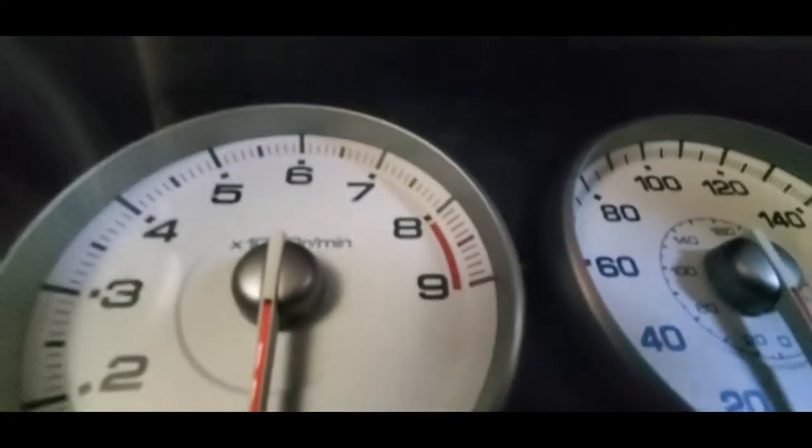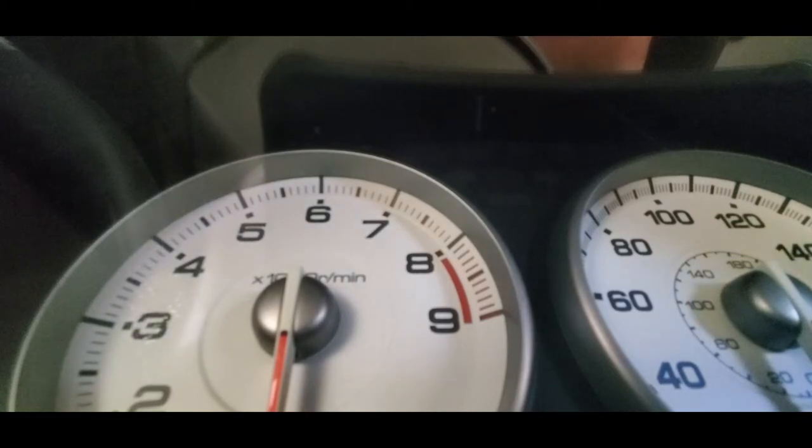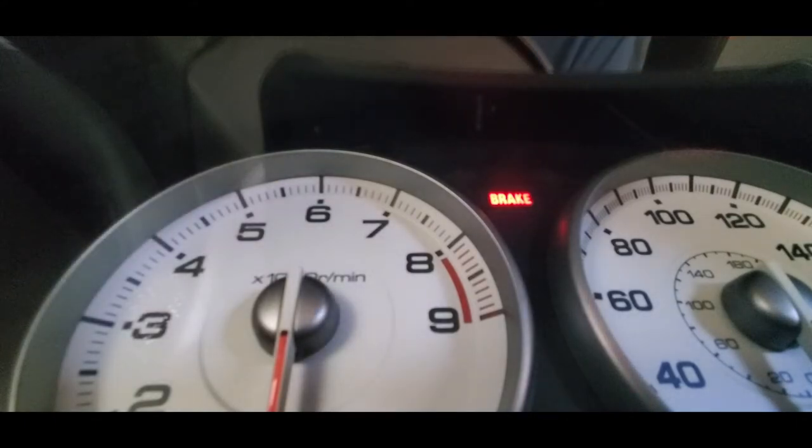So I'm going to try with the 05 06 buckle and airbag. I'll be using the paper clip again. So just turn it off. Disconnect. Connect. Disconnect. Flash. Connect. And it's gone, just like that.